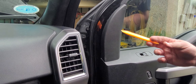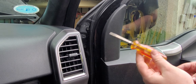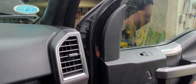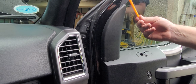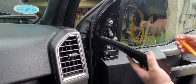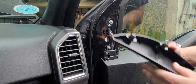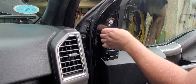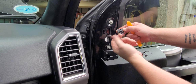The first thing — get yourself something plastic. If you have to use a screwdriver or something, get a piece of paper or a towel or a shop rag to pry it off so you don't scratch anything. I've already got it popped off — they're pretty easy to pop off anyway. You've got two clips here and two clips up here. You have one wiring harness here with a little clip right there; you just push in and it pops right out.